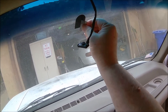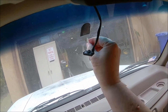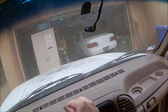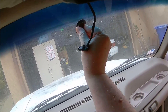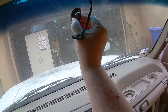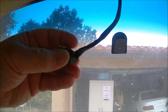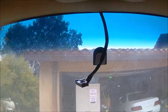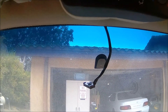If your windshield didn't have a little mounting locator, I would be on the outside with a marker outlining where to put the button. It's going to go right up there like that. Just have to wait for the glue to set up, plug the mirror back in, mount the mirror to the windshield, and we'll be all set again. This is for a 1996 GMC Suburban.